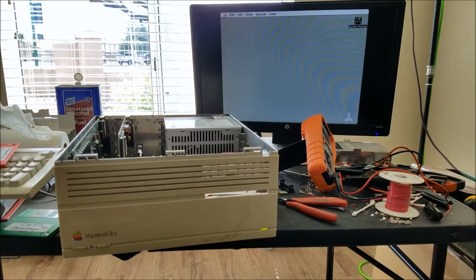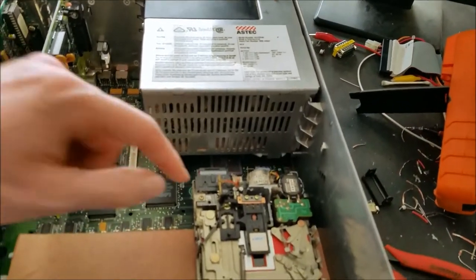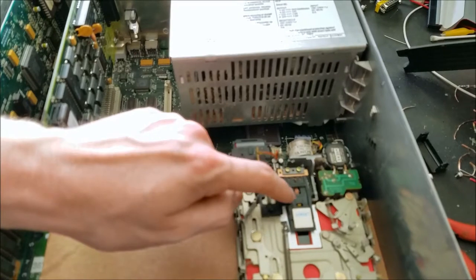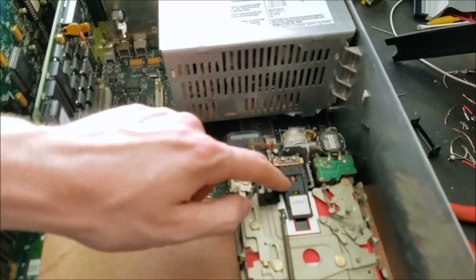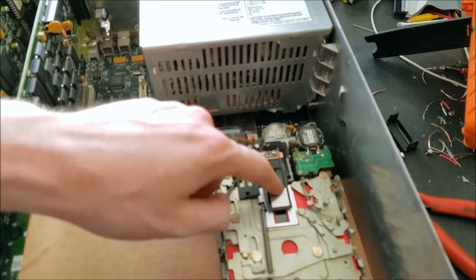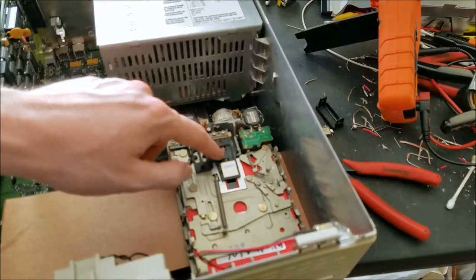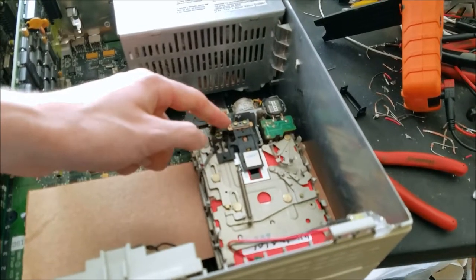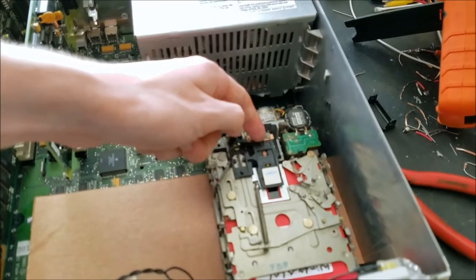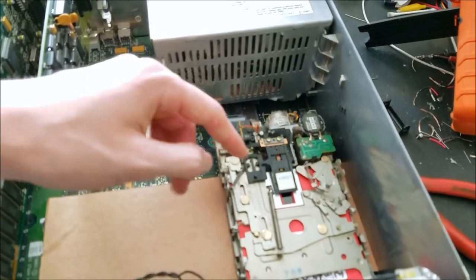I changed my mind and ended up playing with that other floppy drive first. It seems like the problem is actually pretty simple, I just don't know how I'm going to fix it. You can see it's booted now. This head is supposed to be spring-held against the disc, and it's floating above the disc - it can't read anything that way. But if I just put my finger here, it actually boots up just fine, as you can see right there. So pretty simple problem. I'm not sure if that happened when I was cleaning the heads or if it was an existing problem. I think the only thing that holds it is this little piece of metal here providing a little bit of spring force, but it's supposed to be pushing down when I was pushing it up.